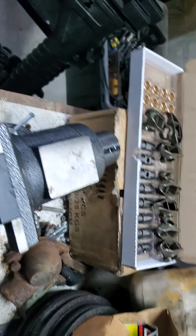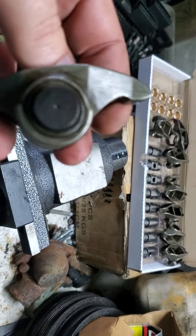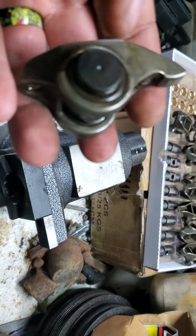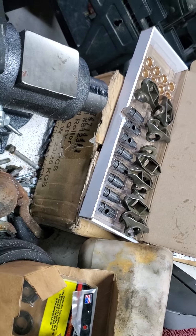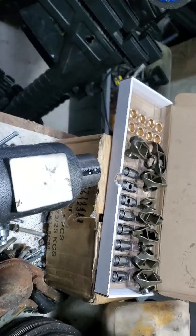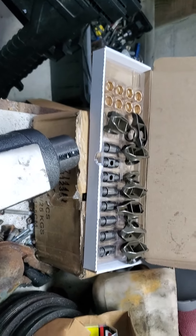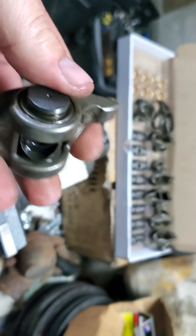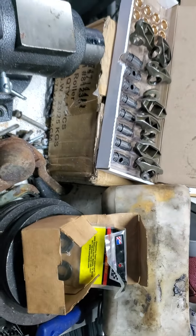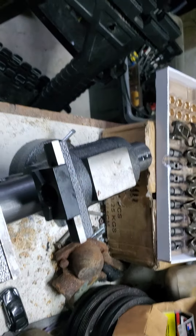If you have LS7-style lifters or rockers, you have to bore the hole bigger for the bushings. But anything LS3, LS1, LS2, LS6, and all your trucks that use the standard offset should all be the same. I haven't had to do a single thing to get these together. These are very noisy.